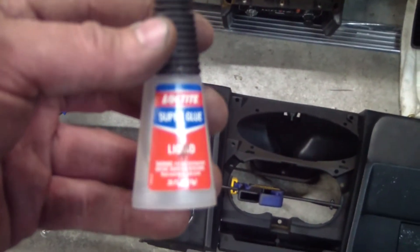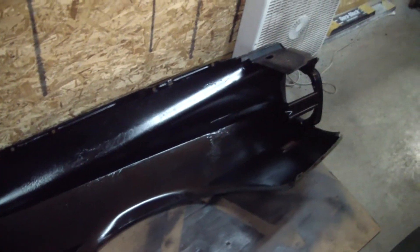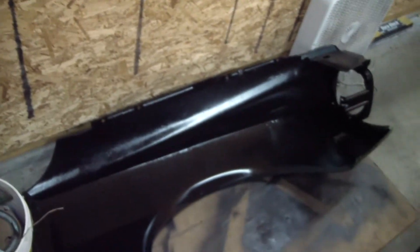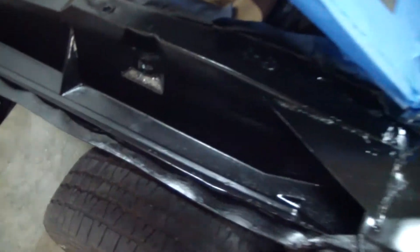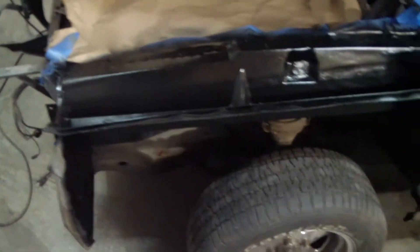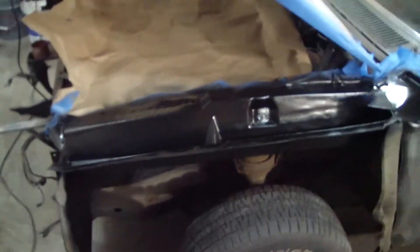Here I got her clamped back in position and I'm gluing her. I'm using Loctite superglue. Here's a look at the fender after it's been straightened. I wire wheeled the inside and did a once over with some rust reformer and some paint. This fender trough is wire wheeled, treated with rust reformer, and painted — along with all the surface rust on this plate and a little bit under here. Just trying to do a quick once-over preservation until the car gets a full restoration.